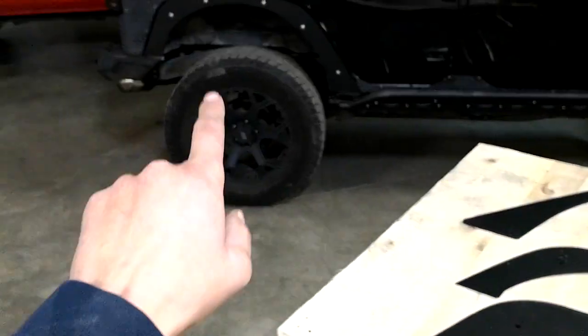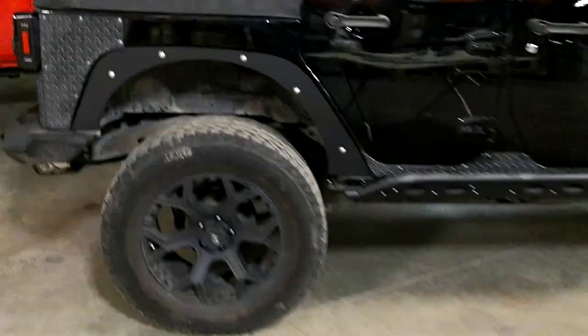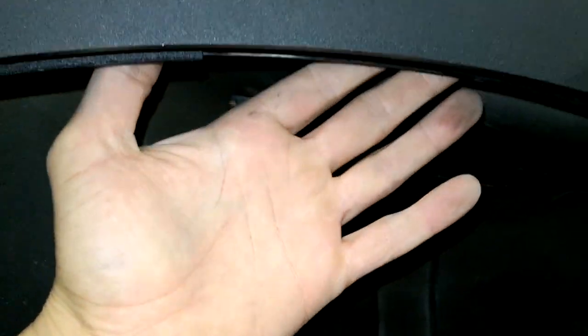The brackets are inserted exactly as you see them on the table here. One piece goes on the back side, one piece goes on the front side, and the third piece goes right on top of those two. The bracket goes all the way to the rear, secured with nutserts, a bolt, and washer all the way down. There will be a gap before the next bracket starts. You'll use the two original factory fender holes plus the former clip holes, where you simply enlarge the hole to accept an insert nut.